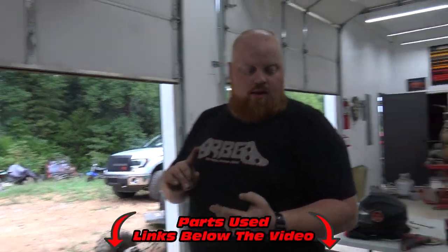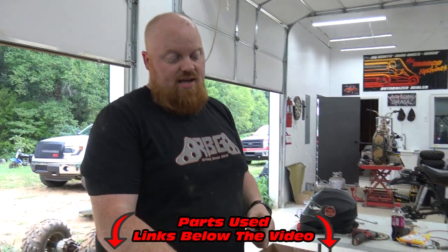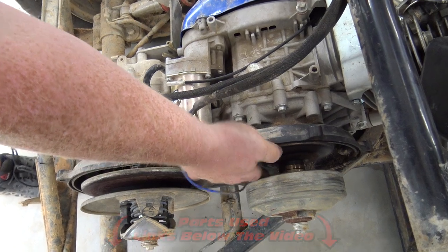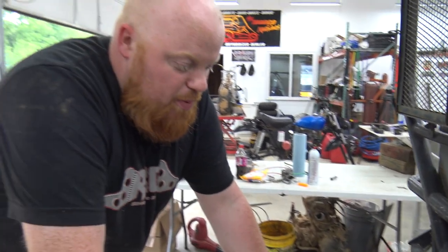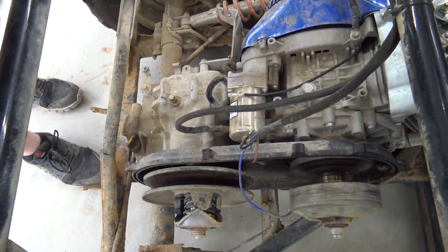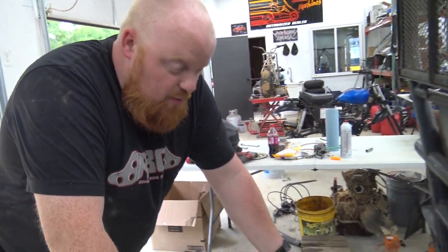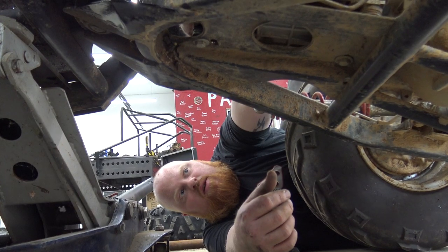The engine has a high torque cam — a marine cam — and a 275 lift cam from Go Power Sports, plus a billet rod from Go Power Sports. There's a true Comet pulley with bushings on it. You can see one of them is locked up from all the belt material in there, but the bushings are still good so that's a good pulley. I'll keep it. If anybody's interested in this diff, I'll hook you up locally — I have two of them.